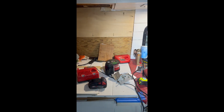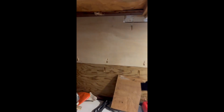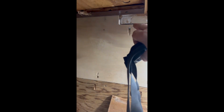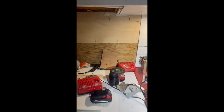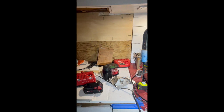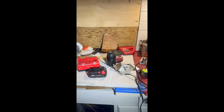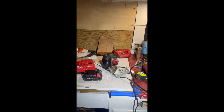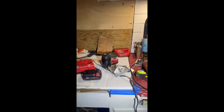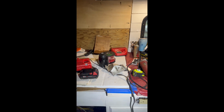But it's not being done because there's a running light that's on the, well, you can see it right out here, probably. Well, maybe you can't. But anyway, through that hole right there, on the other side of that hole is a running light that is not working yet. And I do need to have access to the 2 green wires that are up inside there to find out why. Do I need to run a new wire to it? Again, that's getting back to that front end there where I need to get in and redo the wiring on it.